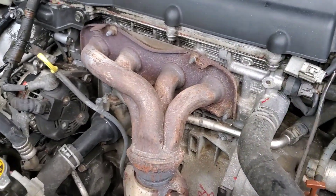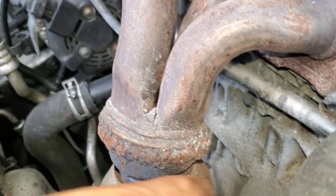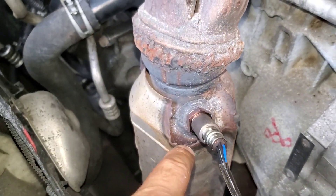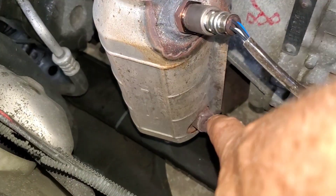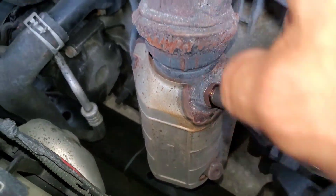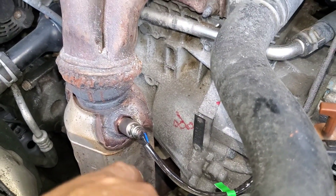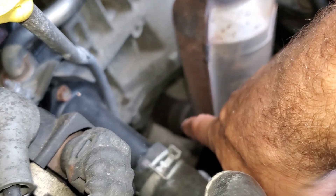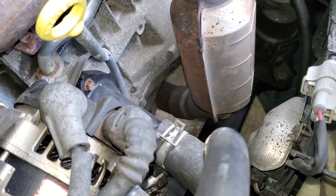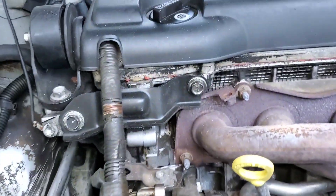You can clearly see someone has welded some ridiculous setup on here. This O2 sensor is in the wrong spot — you can see they cut away the heat shield and installed it here, when it should have been installed down there. This flange should have been down further. This is some jerry-rigged setup. You can see that there's a weld joint way down there, and that coupling they put in there — that's a fix-all.